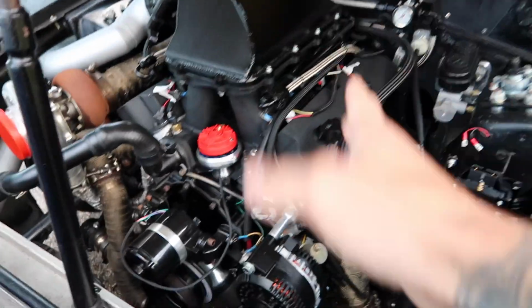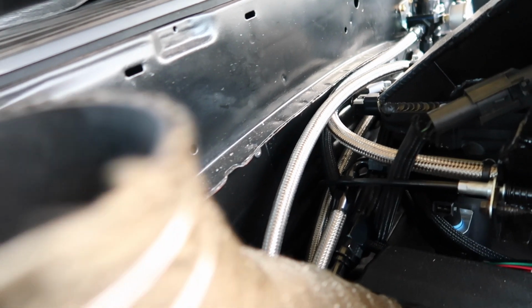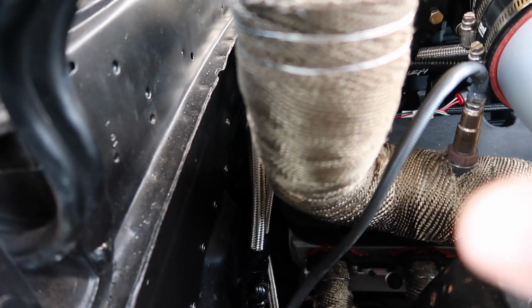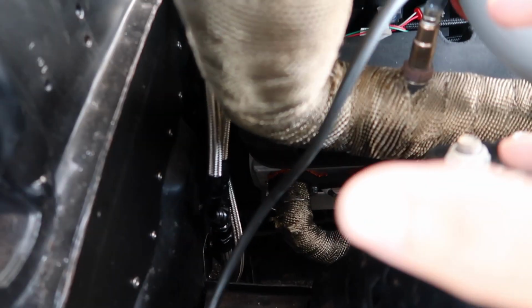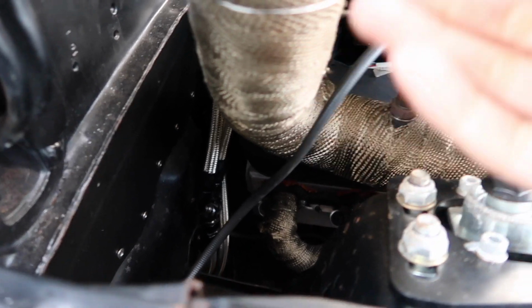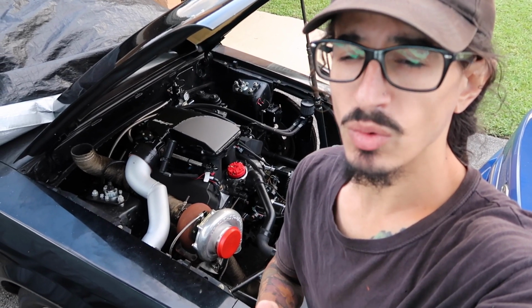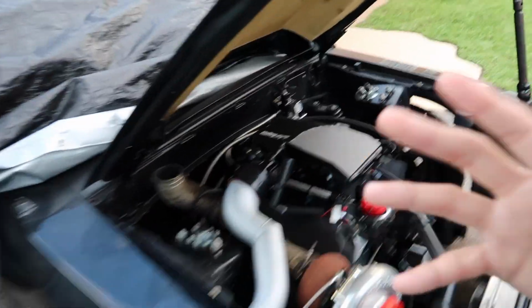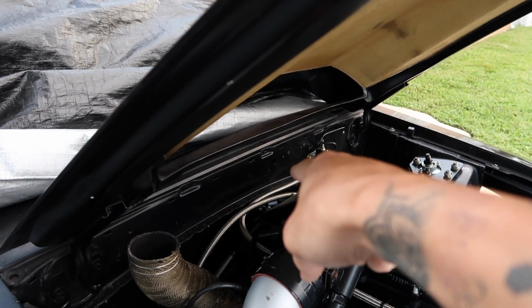So I decided to move the starter cable with this group of wires, but then I had to figure out a new way to route it because it was coming out of the grommet. I had separated it from this group of wires, and then I had it just going down, and you guys know the starter is down here. But the problem was that there was no real way to secure the starter cable in a way that it wasn't touching either the transmission or the back of the head or running into the exhaust manifold. It was very difficult to get the starter cable to run from that grommet on the back of the engine to the starter without it resting up on something. There's not much back there on the firewall that I could zip tie the cable to, and I really wasn't comfortable with that because I just didn't want it to get burned up and me having to replace it in the future. So I decided to revise the way that I routed the starter cable, and I ended up pulling it all back into the car through the grommet that we have there that all of the harness is coming through.